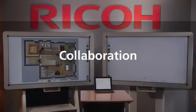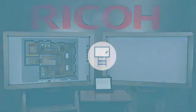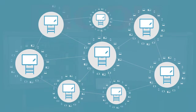What about collaboration outside of a single physical meeting location? The Ricoh D5510 can connect and collaborate in real time between 8 different whiteboards within a network or VPN connection. Each connected board can also have up to 20 devices, such as computers, tablets, and smartphones, connected to it. This means you can have a total of 168 devices that can view or participate in a meeting at any given time.